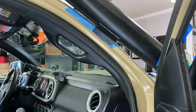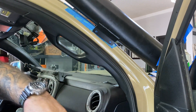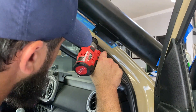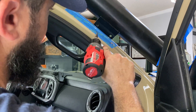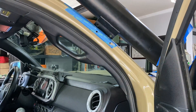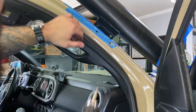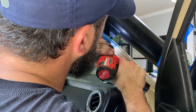At the A-pillar, I've got my holes marked. This is where some people get a little freaked out because you do have to drill in here and use rivet nuts or nutserts. I've got my holes marked where I want them and I'm making a pilot hole first. Then I'm going to 11/32s for the nutsert holes. You want to be careful not to go through the front, so take your time and go slow — there's really no rush.